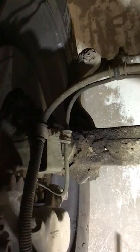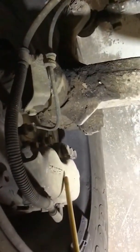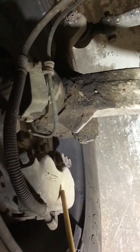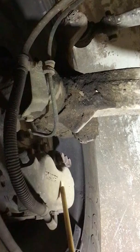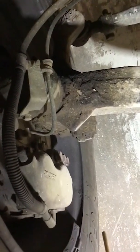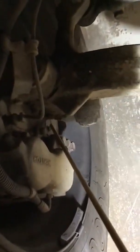Next, we will look at our brakes, and we will tell the examiner whether they're disc or drum brakes, and this one is a disc brake, so we would tell him that we would look at the pad, make sure it's not dangerously thin, and there's no oil on it, and there's no cracks. Next, we would tell him that because it's a disc brake, we have a rotor on here, and on some buses there's an inspection plate, and if you can see it, then you want to make sure that there's no oil on it and it's not cracked.